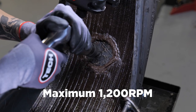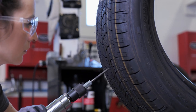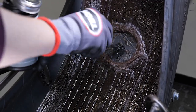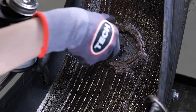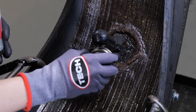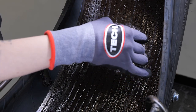Drill out the injury from the inside of the tire and repeat this process a minimum of three to five times in a passenger tire. Next, repeat this procedure three to five times from the outside of the tire to ensure proper injury preparation. The fourth step in the Tech repair method is A, applying the vulcanizing fluid. Apply Tech 760 chemical vulcanizing fluid into the injury from inside the tire using a spiral cement tool. When inserting the tool, be sure to rotate in a clockwise direction. This procedure should be repeated three to five times depending on the thickness of the tire. You'll leave the spiral cement tool in the injury to prevent the vulcanizing fluid from drying. Follow this by applying a thin even coat of Tech chemical vulcanizing fluid to the exposed surface of the inner liner. Do not apply vulcanizing fluid to any unprepared surfaces, as this could lead to contamination of the repair area and the can of vulcanizing fluid.